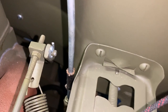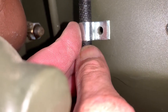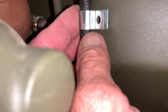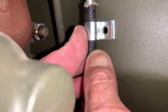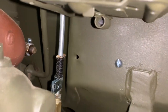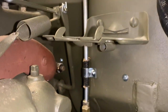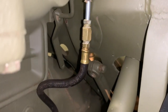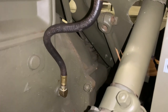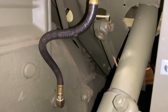We've got a couple more things to do on the outside here. I've put the grommet back in with that slit facing downward. Notice that piece of cloth loom right there — it's going to have a clip installed right over the wire loom. We'll use a 10-24 by 3/4 inch screw with a lock washer, and that hole is right below to the left of the oil can holder. I want to show you this all installed. The clip's all fastened up, and I want to show you how the lower hose should be fashioned in order not to interfere with the clutch pedal travel. We're all finished up — on to the next component.